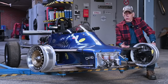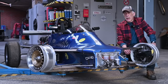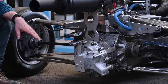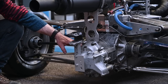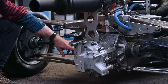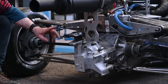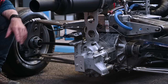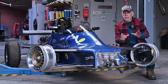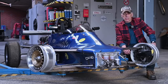The track we are racing on Sunday is called Zolder. It's a highly technical track and I will be able to develop quite some speed. As you might have seen in the previous episode, we replaced some of the gear ratios in the gearbox, so now it's all nicely reassembled, sealed up, and filled with oil. I filled it up, let it sit for a while, double-checked the level, and the oil is good. I configured the gearbox with the proper ratios to get up to speed without running out of RPMs. If you want to see how I did that, check my previous video.